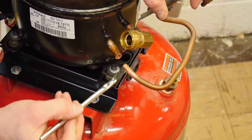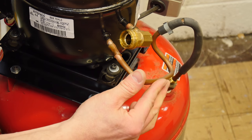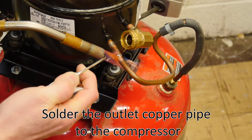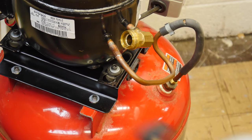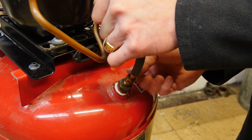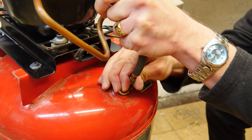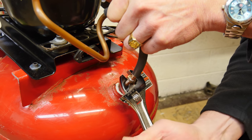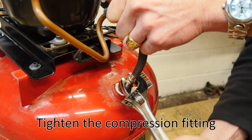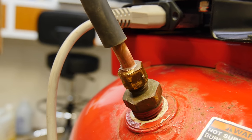We'll add a little bit of flux so that we can solder that together, then heat it up with the torch. A little bit of solder — doesn't take very much, it flows right in there. Super easy. Let's take a quick look at that solder connection — pretty clean. You want to be careful when you're soldering on your compressor so you don't loosen anything up. On the other side I put a little bit of Teflon tape on that compression nut — the little olive that goes on there. I was having a little problem with those compression nuts leaking, and I found on YouTube that people were putting Teflon tape around the compression nut to get them to seal correctly.